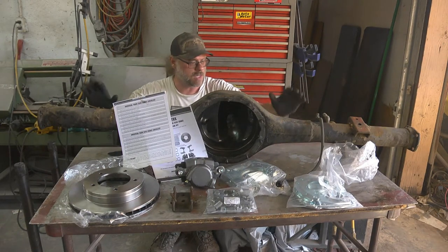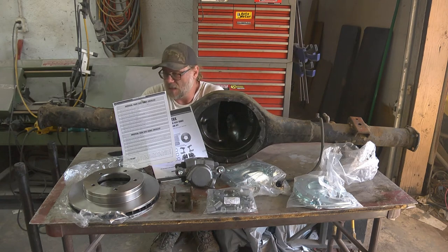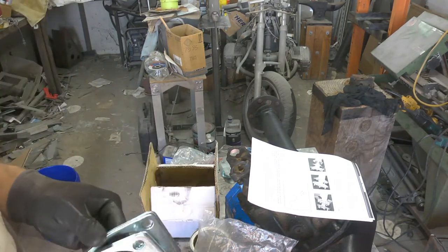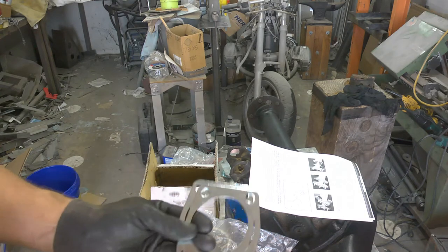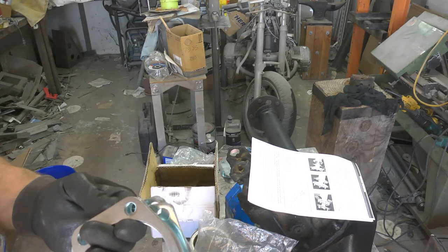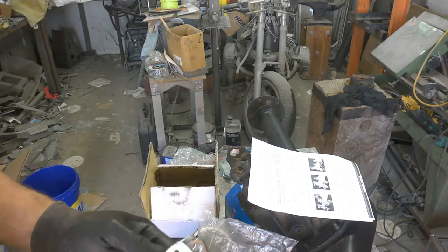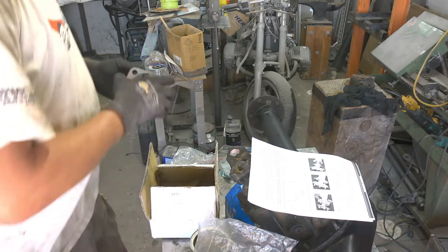Okay, here's the housing, and this is at least half of the disc brake kit. The kit we bought is set up for the different popular axle flanges. We have the large set, which I think is what we got, and then we've got a medium set and a small set. So, first thing, these are spacers that take the place of the backing plate, so they need to go on the end of the axle flange here